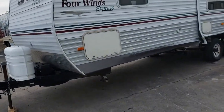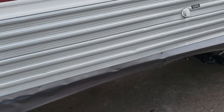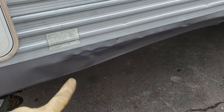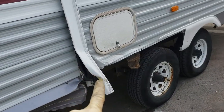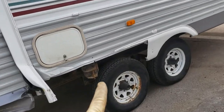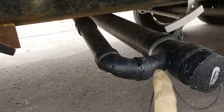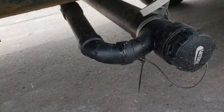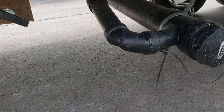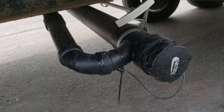Here's the next project. It's a Four Winds travel trailer — on the way down from Idaho they found a curb or a barricade. They damaged the J-wrap here, the slide-out fascia or trim, the Mesa metal, and the fender. They temporarily repaired their plumbing down here, but it's a bad idea to have a tube like that for your sewage, because that's the black side and if you get a big plug of sewage right there — that's a problem.